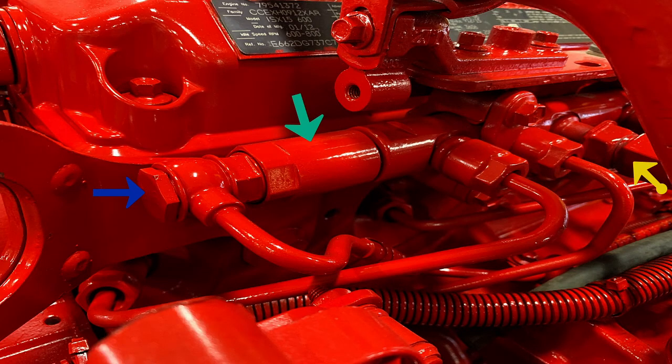In this last slide, the green arrow is the fuel rail high pressure relief valve. If the actuator or the fuel system were to fail and the pump tried to make unlimited fuel pressure, that device would open up and dump fuel back to the tank so that the rail wouldn't overpressure and a line fail. The blue fitting is the banjo fitting that we would take out to screw our test fitting into — you always check for leakage at this fitting. The yellow arrow on the right is pointing to the fuel pressure sensor that is part of the feedback system; that sensor senses between about 6,000 and 40,000 PSI and is quite accurate. That takes us through familiarization of the fuel system. The next video will be the start of diagnostics in the fuel system. See you next time on Neural Splendor.